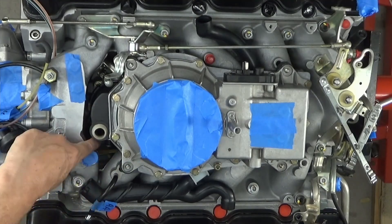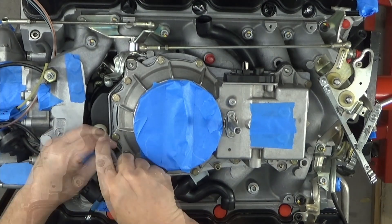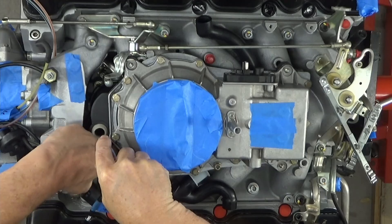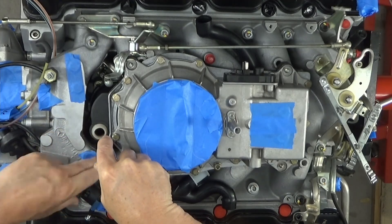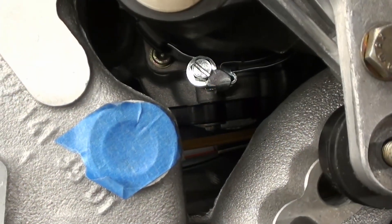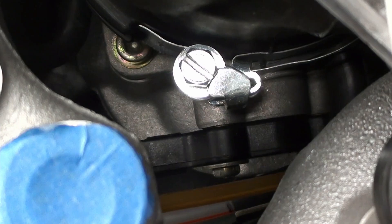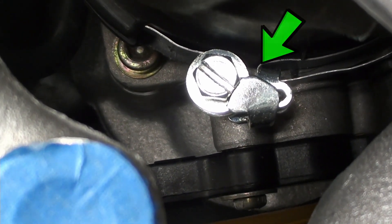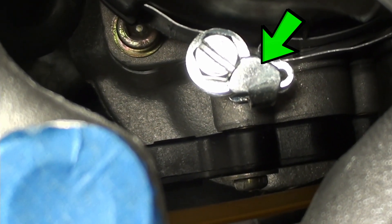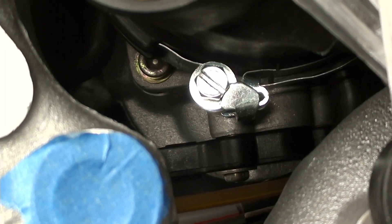You notice the placement of this — it's right there — and that's so you can get a wrench or a screwdriver to it. This is eight millimeter, if you're curious. And that's all there is to it. Now I'm holding a little bit of pressure on there, and now I'm going to flip this lever over to lock it in. You see how that thing's folded inward? So when you have tension on that strap, it wants to back itself out — that's why you have tension on there and then you flip that little thing over. And that is exactly how you lock that in place.